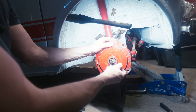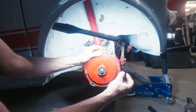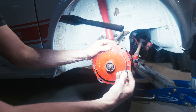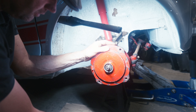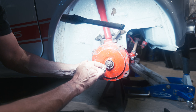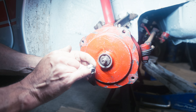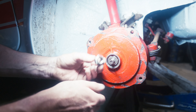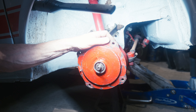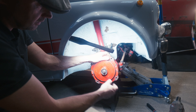These nuts are also colour-coded. This one is silver; the other side's in a gold anodised treatment. So that's another way you can tell them apart. Some of them have different cutouts in them to tell you which one's which, but you can see by looking at the thread. Always make sure to use the right one, and best to replace these when you put them back on. You could reuse one, but it's best not to — buy new ones, they're cheap. If you've got one of these cars, keep a couple of each in your spares.